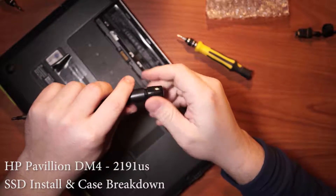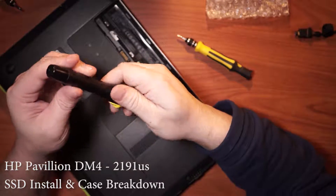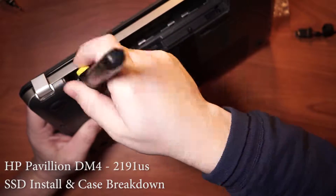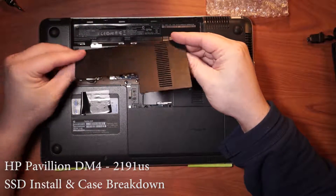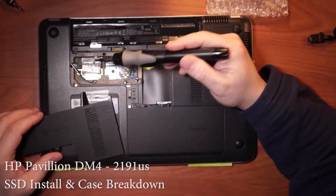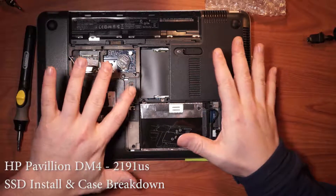I do like this one if we're doing this a lot — it's anti-arthritis medication I guess. This runs on two AAA batteries so they're not very powerful — stripping the crosshairs is not likely. Cross-threading going the other way, you should be able to feel it as it starts to cross-thread. You always want to start it by hand and then use the power function. So I'm just going to find that screw right there — that one's out. I believe it should just slide that way. So then we've got just these clips here, and this is where our RAM is if you wanted to upgrade. This is just a cover. There's where our RAM would be — BIOS motherboard battery, Wi-Fi I believe. Taking this off exposes that screw and that screw, which allows you to pull that off. Really easy to take off so far.